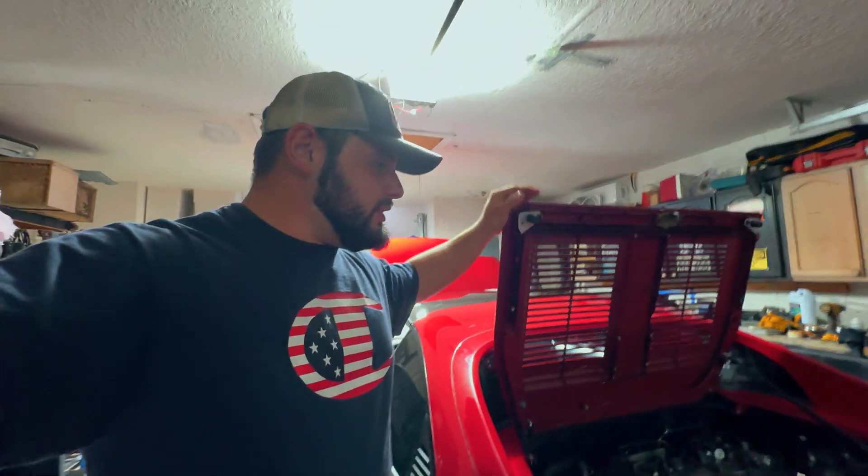You're probably asking yourself, why do I keep referencing the Toyota RAV4? Well, that is because from all the factory 2GR-FE applications that are out there, that is the only one I am at least aware of that had a coolant expansion tank. Most of them have tanks where it's like a normal pressurized cap on the top of the radiator, with a little small T that comes off the radiator cap into an overflow tank that isn't pressurized — that's only for sucking coolant back in or letting it boil over. Since this is a 2GR-FE and the MR2 was never really designed for a coolant expansion tank, I said why not try to utilize the factory system that Toyota decided to do on the RAV4 with this exact engine.